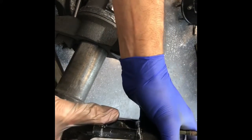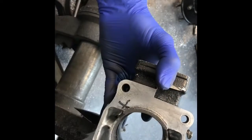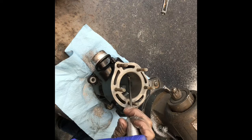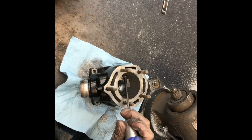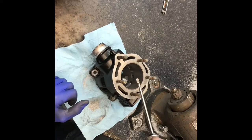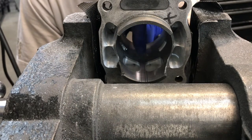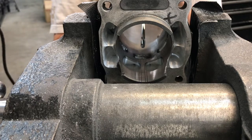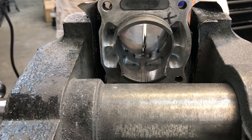I think that does it for this one — intake is pretty much done. I'll move on to finishing up the transfer updrafts. This is how I start moving all the transfers up: I go in and take the liner up to the line I marked, and I go around each one of these and raise them. Whatever duration this port job calls for — that's roughing them in before I do the 90-degree angle tool. Just trying to do the boost or bust port here, long shank coming through the top. I just raise it up.